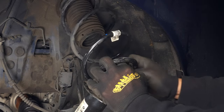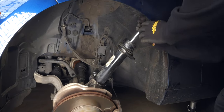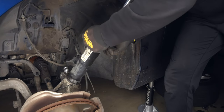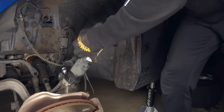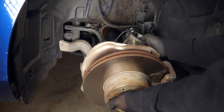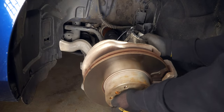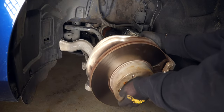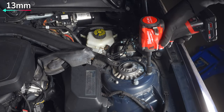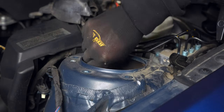On xDrive cars, there is a chance that the axle might become misaligned. In that case, pull the strut out as we did here and before bringing in the new strut, just realign it. Initially, you might feel some binding if you try to just press it in. Rather, move it in a circular motion with some light forward pressure and let it fall into place. Don't force it in — when it drops in, it should feel effortless. Another thing to look out for is if there was another gasket previously installed — if so, remove it before placing in your new one.